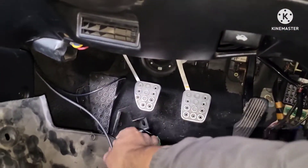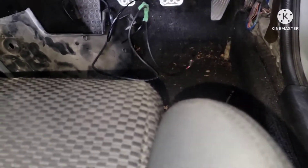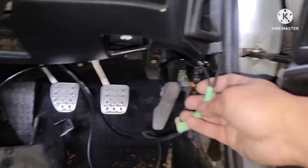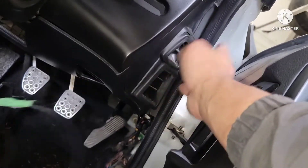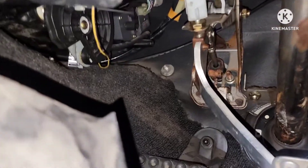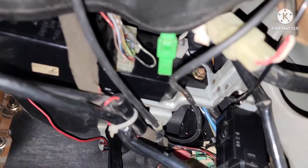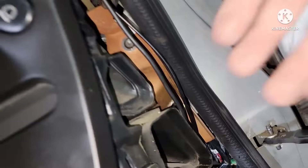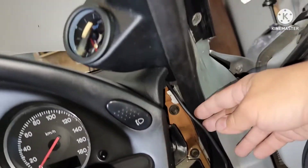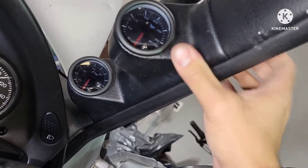Right side — there are those two lines right here. I use this little stick to run it through so it's easy to fish it out. This goes into the A-pillar, behind this dash right here, and it goes in right here. It's getting dark now. The wire is tucked underneath right there, goes behind the clutch, brake, and gas pedal, goes up right here. Those two lines — oil and boost — and there she is right here.